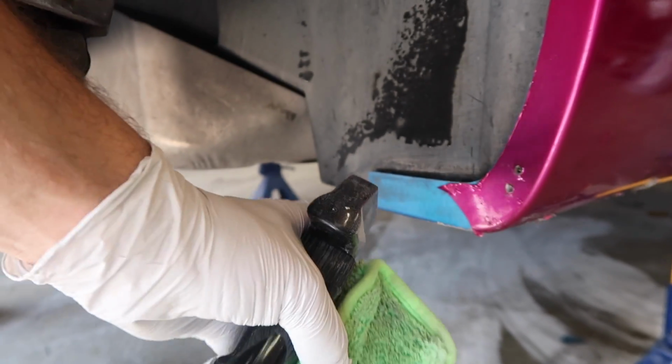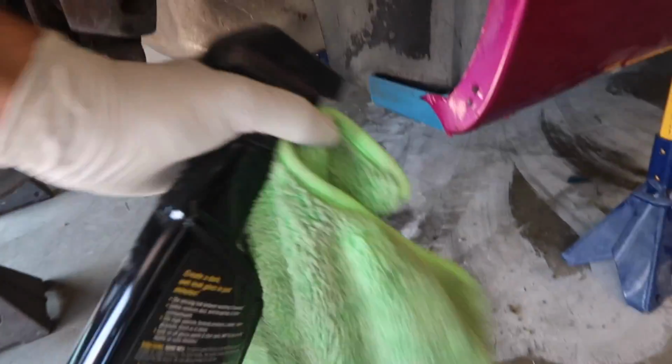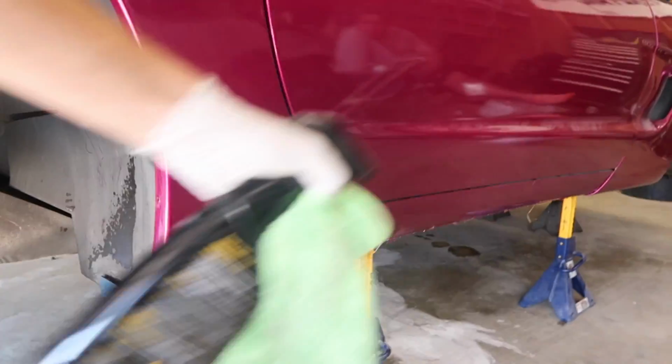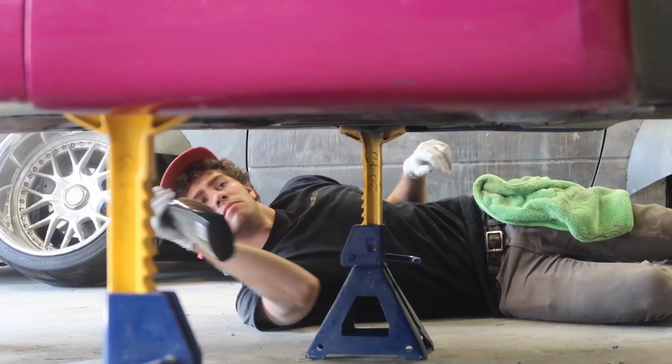You can see that blue right there whenever I'm at shows, so I'm gonna Plasti-Dip that, but I'm gonna have to wipe off this quick detailer because obviously this is like an oil and it won't stick to that, so I'm gonna wipe that down with some alcohol, spray both these sides, and then we can start going along there and actually mounting the whole skirt.